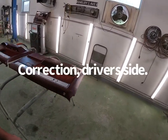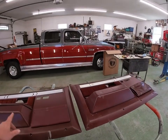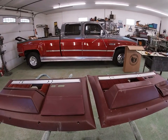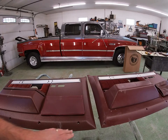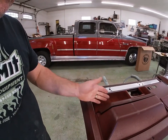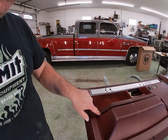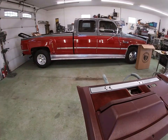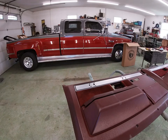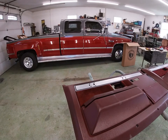We've got our driver side panel. I've already swapped out the inserts. The one thing I've got to do now is elongate this hole to accommodate the four-gang power window switch. So we're going to lay this out and get this cut. This side is the same as the other — the color matches real nice, the trim is real nice. I kind of really wish they would have put this boss in here for this screw, because this is the reproduction armrest and it has this little notch for that. Maybe I'm being too particular, but I really think having that there would have been nice.